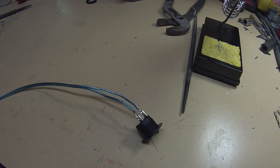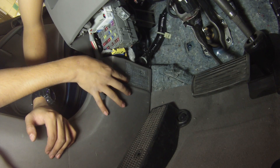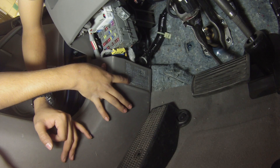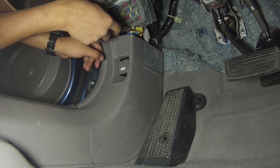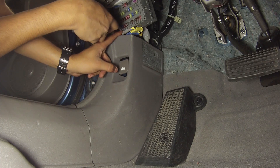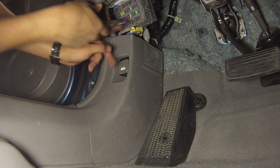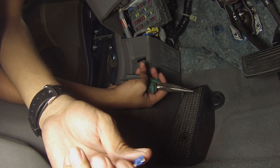The next step is finding the fuse on your vehicle that will stop the car from starting. I've located the fuel pump fuse — be careful in there because some fuses are airbag-related. I identified this one as the 15-amp fuel pump fuse. If you pull this out, your car will crank for a long time and never turn on. Let's go ahead and try that out now.